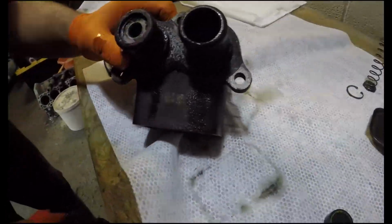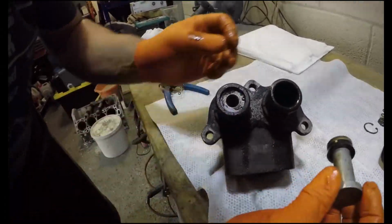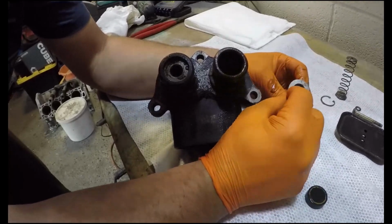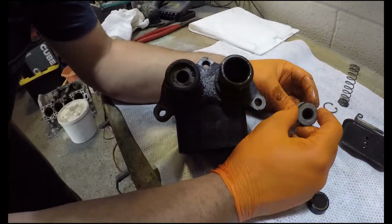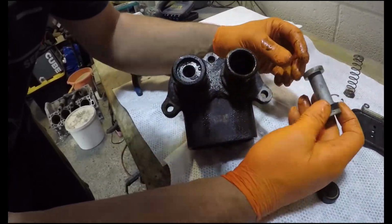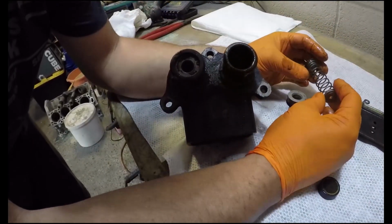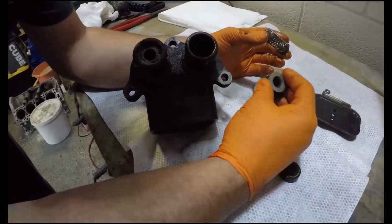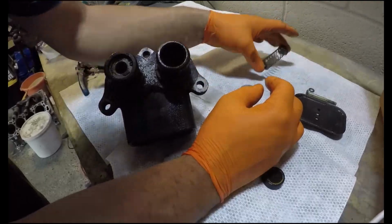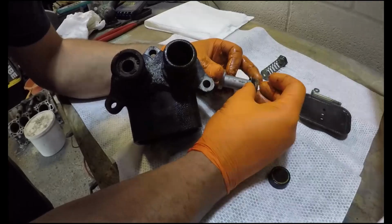It's not particularly corroded. No, that's it. It's basically all you've got. So you effectively have just your piston, which is where the back of your pedal goes into. So you've got your rod going in there. Then obviously that slides in and out of that bore, and that pushes and pulls the fluid backwards and forwards. Now, if you've got a sticky cylinder or sticky piston, you've either got a weak spring, or the spring has snapped, or the seals inside the cylinder themselves have flipped over, because they can.